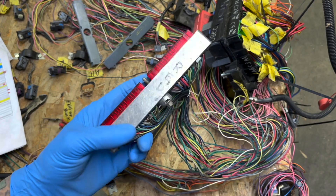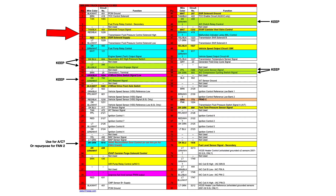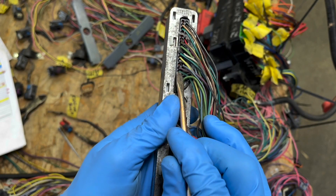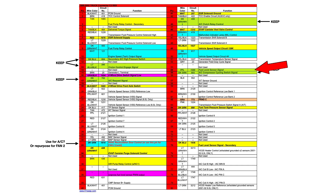On the red connector, I need to keep pin 6, pin 8, pin 42, pins 47 and 48, pin 51, and pins 62 and 63 — the gray wire and the pink wire. The purple one on pin 54 also goes to the fuel tank sending level gauge, so I'm keeping that too. The wires for cruise control are also on the red connector: pin 13, pins 20 and 21. Since I'm keeping AC, I'm keeping pin 17, pin 43, and pin 55, which is the dark green wire.